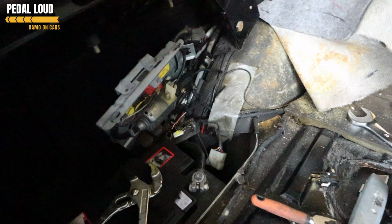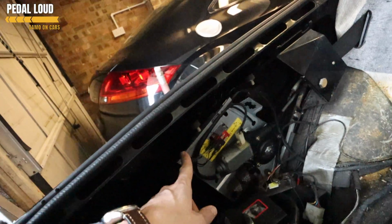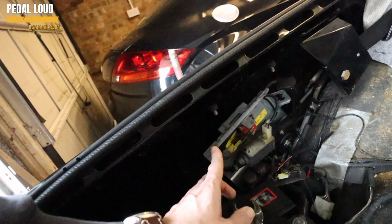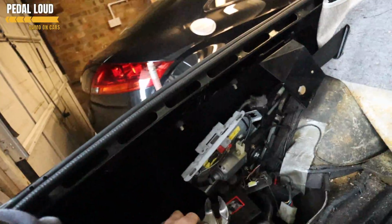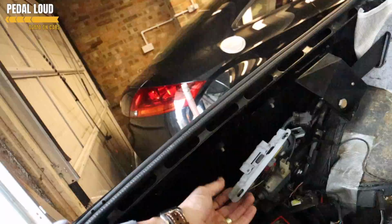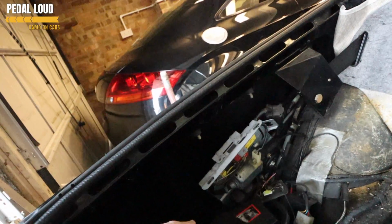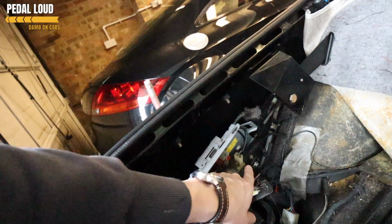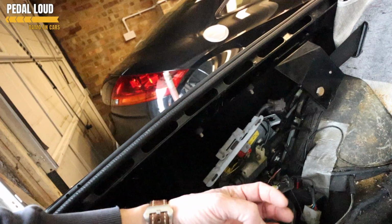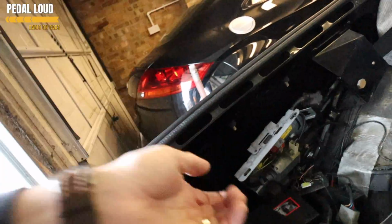Okay, so a few days have passed and we were struggling a bit with the sunroof mechanism. Let's explain a bit more about how it works. It's easier when you're trying to sort it out. If your cogs have been stripped, it's generally because the clutch in the motor that retracts the arms through a wire, this is the motor, the wire goes down underneath there, snags and doesn't disengage, and it rubs the plastic cogs against the arms and strips them.